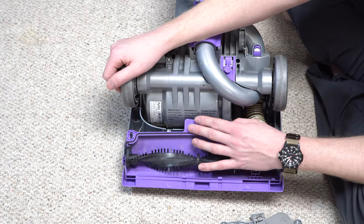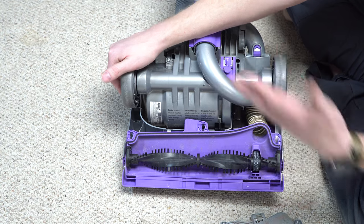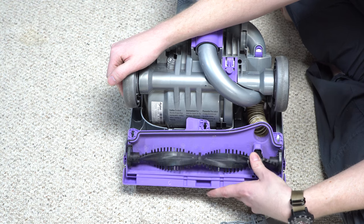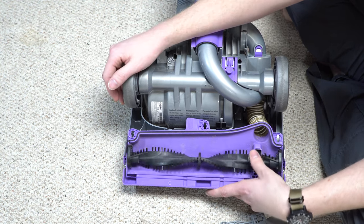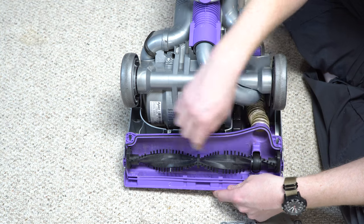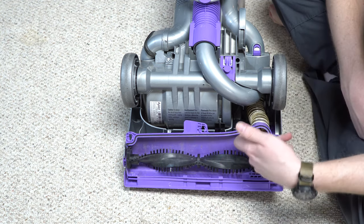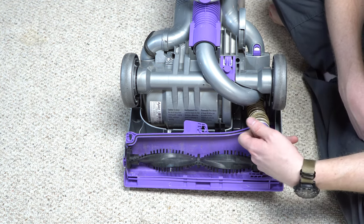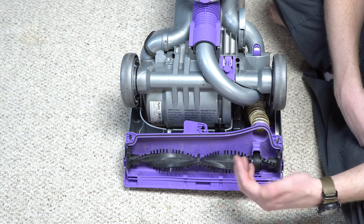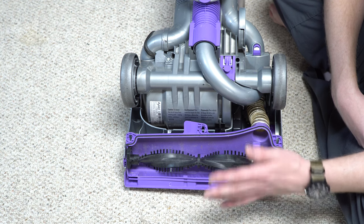All this was okay by dealers who didn't know how to properly argue why a customer shouldn't buy a Dyson at the time. Now that they've been on the market, we know the quality is pretty bad and they're extremely high maintenance — that's the argument to be made. At the time, they had side-feed suction — not exactly all the way off to the side, but it is side-feed suction, which means one side won't clean the same as the other. On hard floor or deeper pile carpet, that's quite bad — uneven cleaning paths.